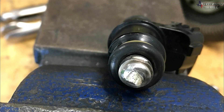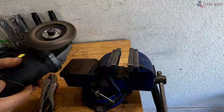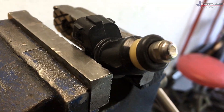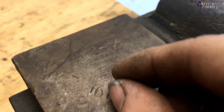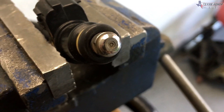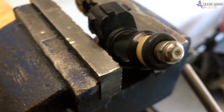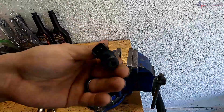It's kind of hard to see but here's a picture — you can kind of see where the crack is at, that's it separating the cap, just a little bit more to do and then it'll be fully off. You can kind of see the cap there is separating, I can actually peel it with my fingers. Be very careful not to grind the center — you can see there's a spot right there in the center you don't want to grind. It's actually a pretty simple task to decap the injectors.